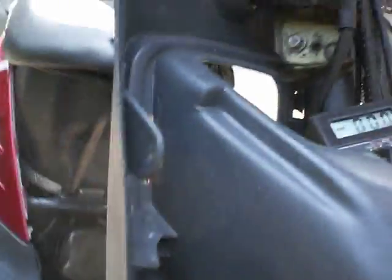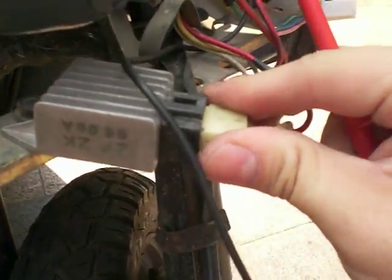So we can see there's definitely voltage coming through here. Let's see if we've got any DC volts on these. Let's try the white one — zero. Green one — zero. The red one, of course, we're getting 12 volts because that's directly connected to the battery. And let's try the yellow one — zero. So let me hook this up — now it's hooked up, and let's see what kind of voltage we're getting when it's hooked up.